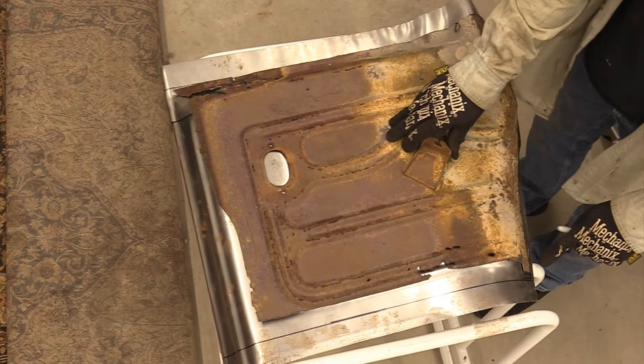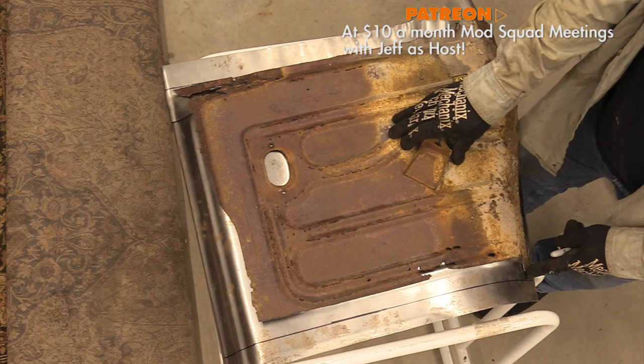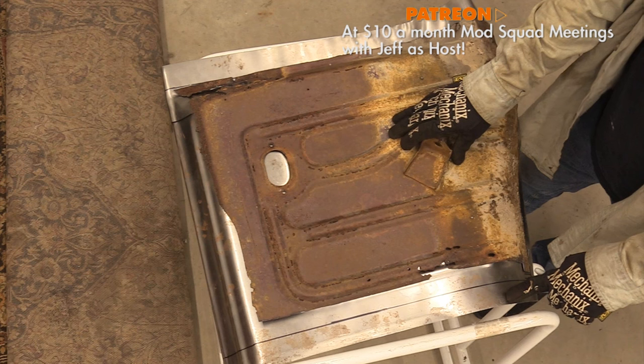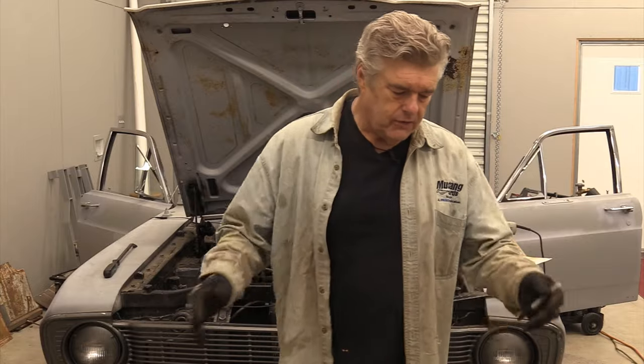One thing I said before that I'm going to go into a little deeper now is measure twice, cut once. What I've got here on this floor pan - I kind of almost made a mistake, because originally on this line section over here, I have the original pan cut back. I had the original pan cut back to here, and this is not actually where this pan ends. This pan from AutoCrafters is about the right distance from here to here to match what's in the car already. Remember folks, it's always easier to take it off than it is to put it back on. So if you cut it right, you're fine.